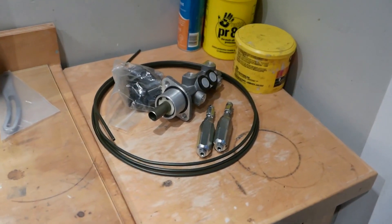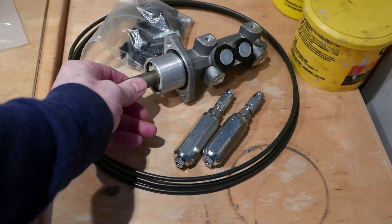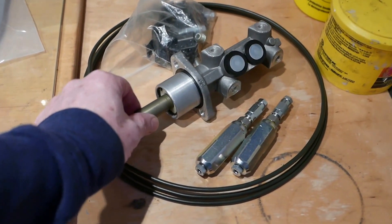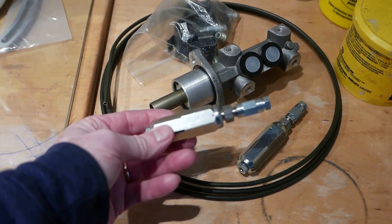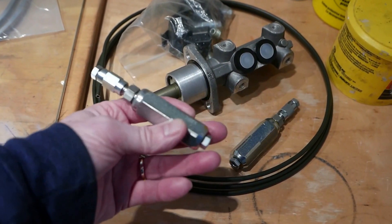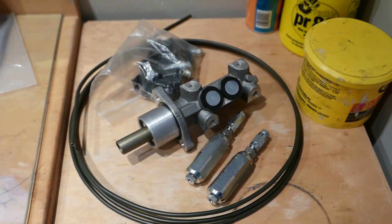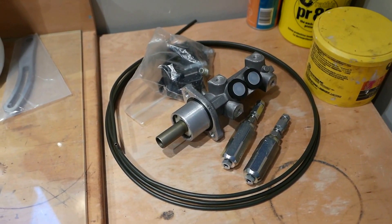So I've been working on various things. This is the 25.4 millimeter master cylinder, which I'm thinking of putting in. It says 25, but it's really a full inch — 25.4. And then these I got from the guys in the Netherlands, and it's a nice set of fixed line. They're called 3-15s. I'm not exactly sure how much they drop, but they are a fixed line proportioning valve.